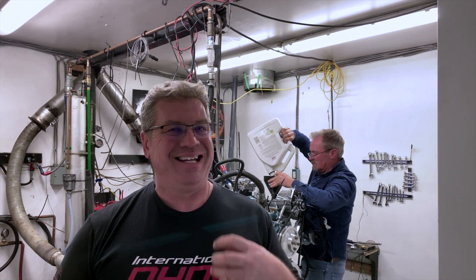We finished the break-in phase and did a mini pass. It's telling us where we need to go — it's extremely lean everywhere, a little bit hard starting, but once you get it going and running along it runs absolutely great. We're going to monitor fuel pressure first, make a couple of changes. We just did an oil change. We may check the valves to see if they've tightened up or loosened — they usually change in the break-in phase. We're probably going to bring the fuel pressure up a little bit and then make another pass.